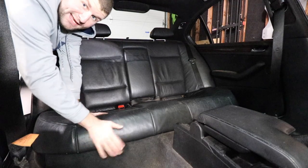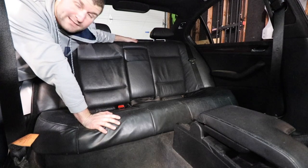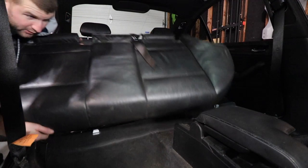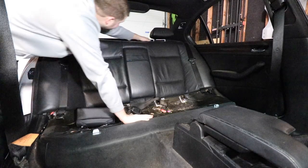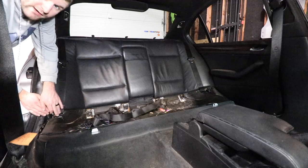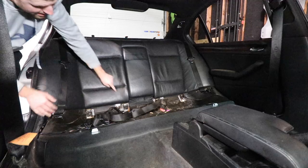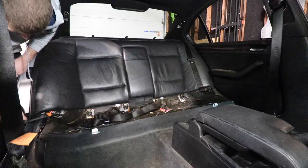Next up, we've got the back seat. These may be a little bit different depending on your car and whether or not they're foldable. On this one, you just literally pull up — and that whole cushion just comes out. Take the headrest off. Now we can go ahead and remove this back panel. You basically just pull up on it and it should pop out. We'll do it on the other side and then up here as well. There are two more places you have to pull up, and then it should slide right out. Hopefully we don't break anything, but I guess we'll see.